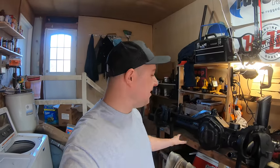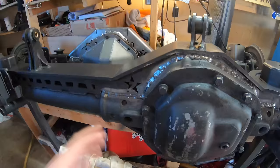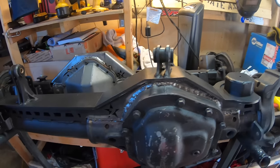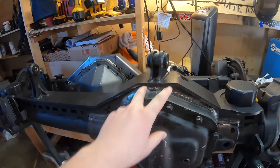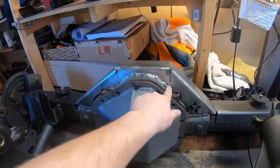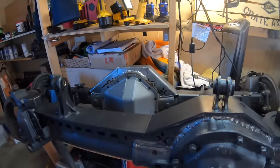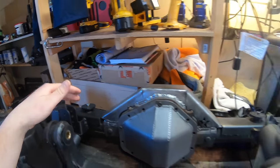Our axles are fully welded completely — we are done welding the trusses on the axle. I let them cool down really good last night and none of them have any cracks, which is awesome. On the front axle, I went ahead and welded the whole front section as well as the tubes to the axle all the way around. Main reason I did that is because we have a link mount up here and it's nice to have that extra strength. On the rear axle, I did the section down here as well as over there and about a 10-inch section up on top. If you're running a triangulated four-link or three-link with links up here, it'd be a good idea to finish these welds all the way down on the other side too.